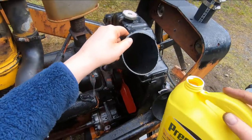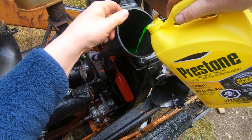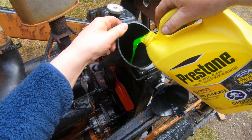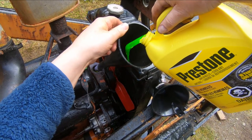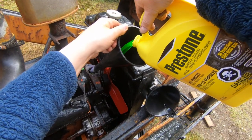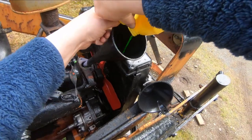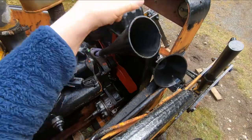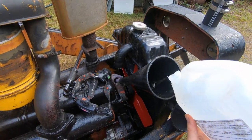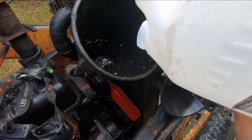I'm going to fill it with coolant first. What I like to do on any engine is fill it through the thermostat opening right up flush to where the top of the thermostat is, before I put the thermostat in — that way I know there's no air pocket behind the thermostat. This engine takes 4.2 gallons of mixed coolant at a 50-50 mix. This is one gallon of concentrate, so I'm putting that in and following it with a gallon of distilled water and continuing that process until it's full.